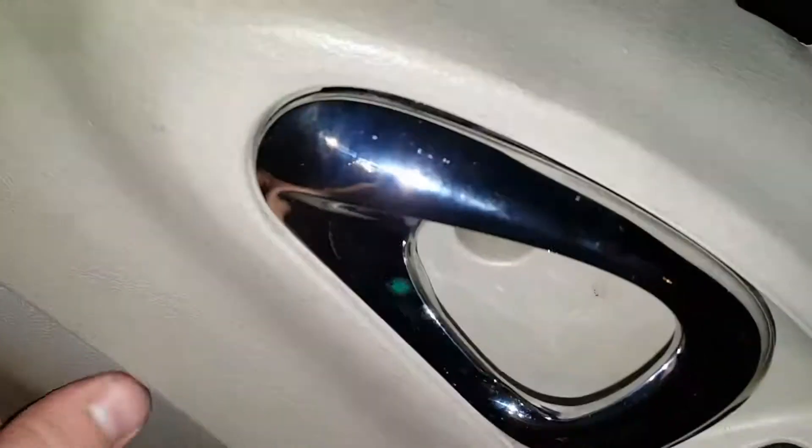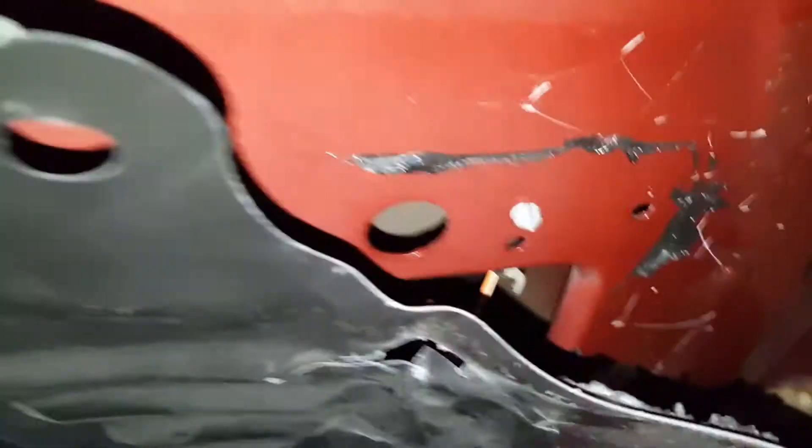So what I'm going to show you here is where the motor is. I've taken the whole door panel off. To do that, you've got a screw here, and two star bits — one under here and one under here — so a total of three screws. Then just take a pry tool like this, a trim remover. You get underneath here and look for these pins. I showed that in my other video for the door, but I just want to show you where this window motor is.